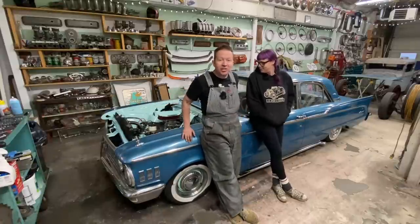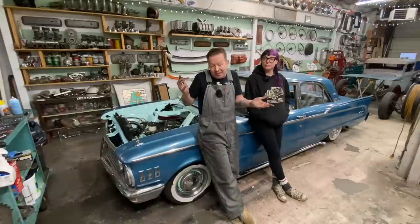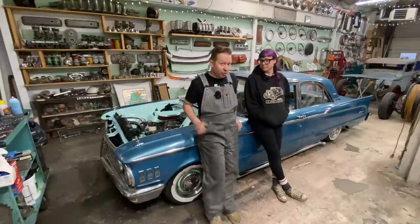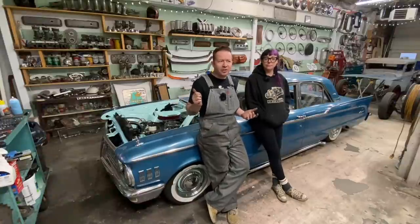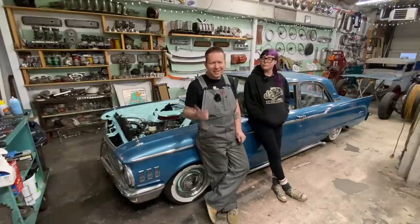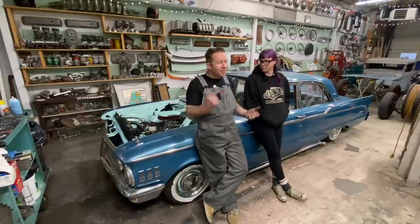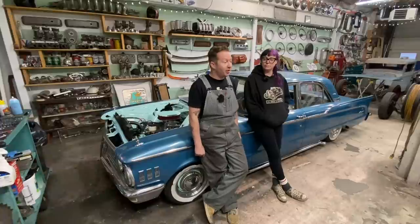Like I said earlier, Shannon bought this engine for $300 off Marketplace. The guy pulled it out of his 91 Mustang. Why he pulled it out, I don't know. Maybe, hopefully it's not pooched, but I mean, it could be. It seemed to have good oil pressure when we were cranking it over. And before Shannon detailed and painted it, we pulled the pan off and looked at the bearings. They looked fine. Everything was nice and clean inside. So he said it only had 178,000 kilometers on it, which I don't know what that is in miles, not a clue, but it's low. It's not a lot. So hopefully it's okay. The C4 transmission, that was just a Marketplace thing. We don't know any history on it, but hopefully it all works.